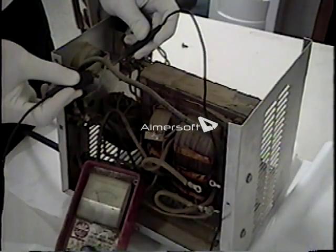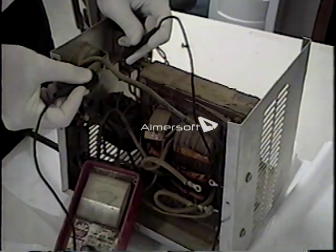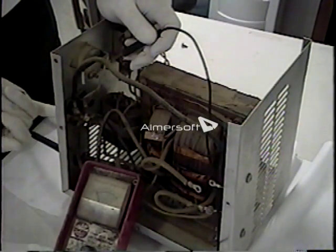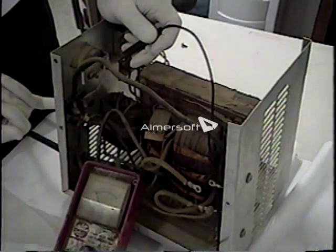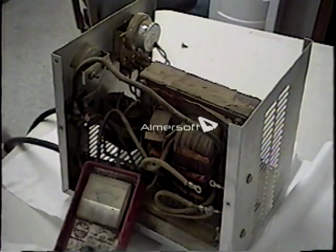That's the capacitor storing up and releasing its charge. The next thing we're going to test is the amp meter. We have to disconnect one side of the cable to test the amp meter. We should have ohm continuity through that amp meter — that tells us there is flow through it. Right here is the fuse, and we should have flow between all three posts of that fuse. Usually when a fuse blows, it discolors this clear lens, but not always. So we want to probe it and make sure we have good continuity across the fuse.